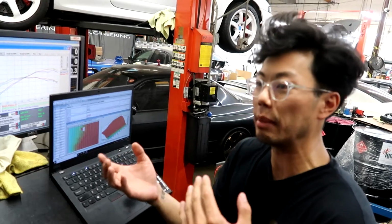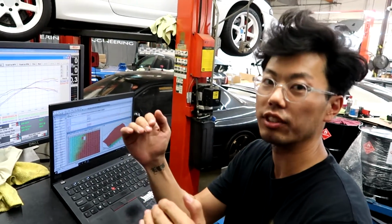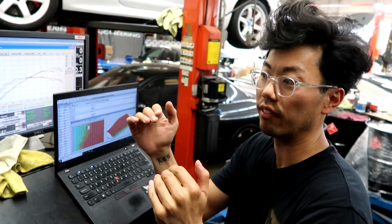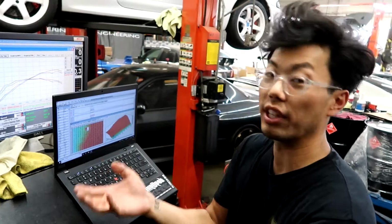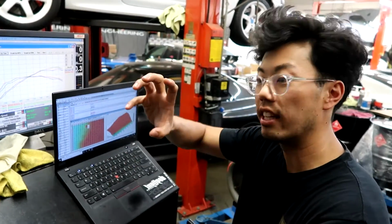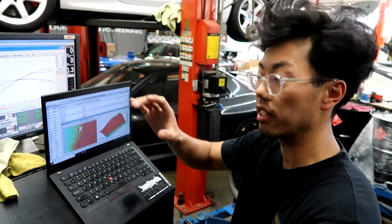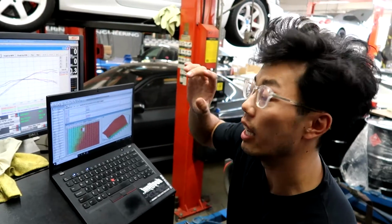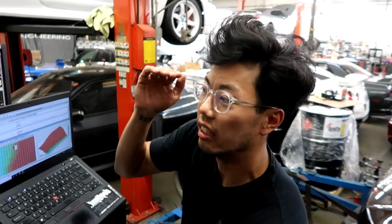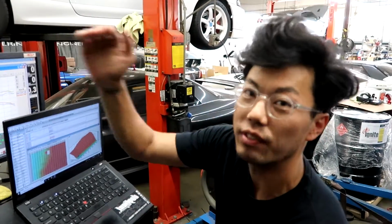If you think about B series tuning, of course there's the low cam and the high cam, so there are different fuel maps for the low VTEC cam and the high VTEC cam on the camshaft. But with the K series, you also have cam timing, so your intake cam is moving 50 degrees to 0 degrees constantly, depending on how you tune it. And what Honda does is they literally have a low and high map for every 10 degrees of cam timing.